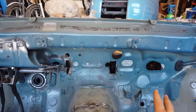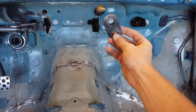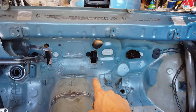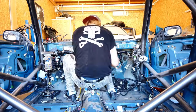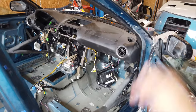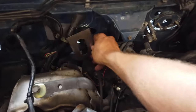What's going on with the firewall is we have two big holes right there that are meant for the lines going into the heater box that sits about right there in the middle. With the beam off, I can place the heater box in here and then find the right positioning of the lines and the grommets that hold the lines inside the firewall. I have some plates to patch those holes that have the exact same dimension as the grommet. I've just finished placing the heater box with the dash and all the wiring in here — it all lines up perfectly even with the new dash beam. Now I have the exact position of where my lines will go from the AC and the coolant. I can take my plates made earlier and weld them in in the correct position.